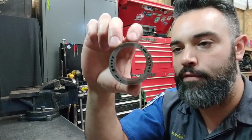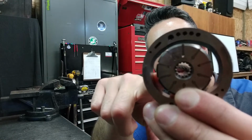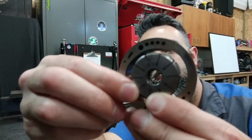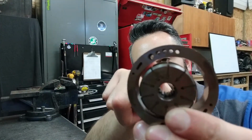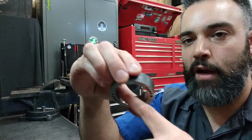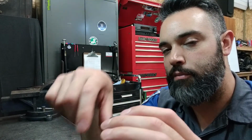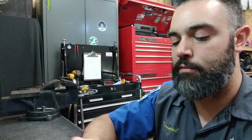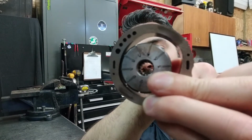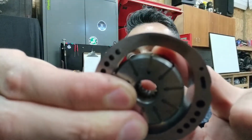It's going to spin inside of an elliptical chamber. So kind of an oval shape where there is more of a gap on one end and another end compared to on the sides. So those vanes inside the power steering pump from the impeller are being spun and the force is bringing them outward against the inside of the pump housing. As those vanes are flung outward against this wall, due to a pressure differential created by the movement of the fluid, and it's important that there is zero air in this system, has to be free of all air, only fluid, it's going to allow fluid to come in one side and move it across, and then there will be a restriction on the other side as this is rotating through and the vanes are moving the fluid over.